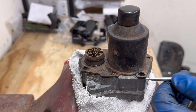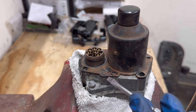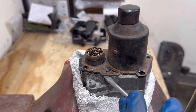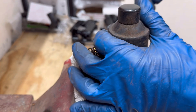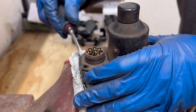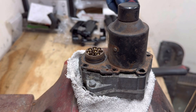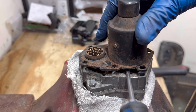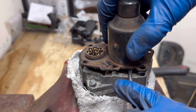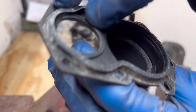These are the long encoders from '91. Let me get my little hammer here. I've got a little bit of a lift here, so I'll start on this edge. See, it starts to come up and I'm just going to work my way around so it comes up evenly. It's just good practice to get it broken all the way around so the thing comes out smooth and doesn't bind or break anything. All right, we got the lid lifted. I'm going to put the screwdriver in there and it should hold the rotor — wiggle, wiggle, wiggle.